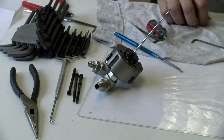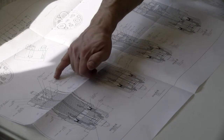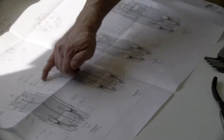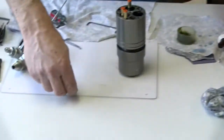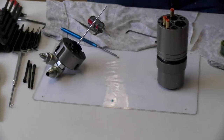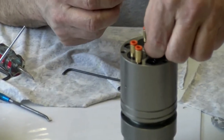And the protruding end is going to seal the seals that go right in here for the actuator. You have 2 seals. It calls out right here: you have an 007 O-ring, and you have the Trelleborg rod seal. Here's the Trelleborg rod seal, and here's your 007 O-ring. Now I'll lubricate the O-ring, and I'll set the O-ring right here in that center hole.